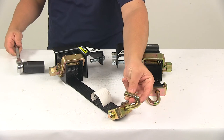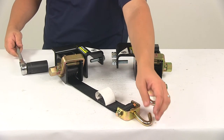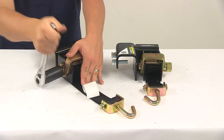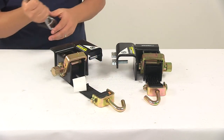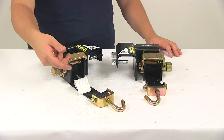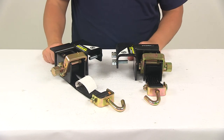That hook is going to have a diameter of 0.515 inches, which is pretty close to a half inch diameter. Once you have that connected, just place the socket and wrench over there and tighten that up as necessary. When you want to make sure that you have the same tension applied to both sides, all you have to do is pick a starting point and count the clicks of the ratcheting mechanism to ensure proper tension on both sides of your trailer.